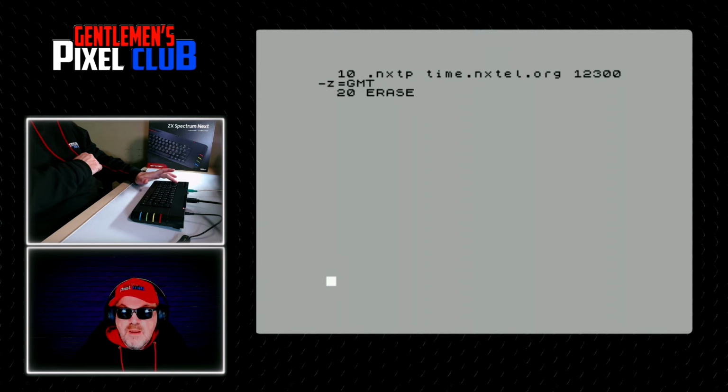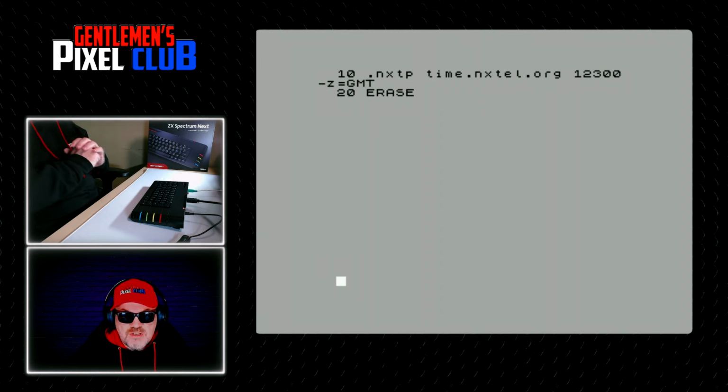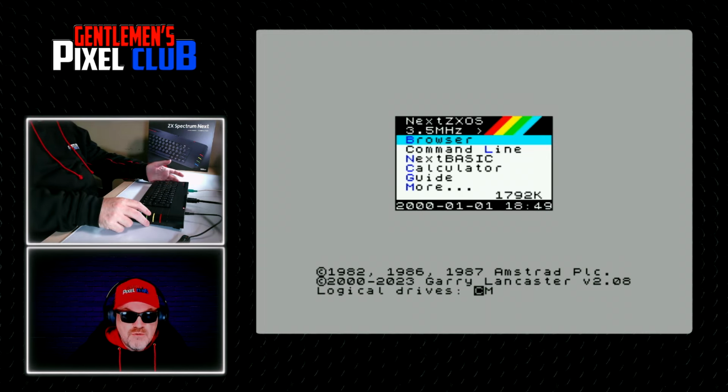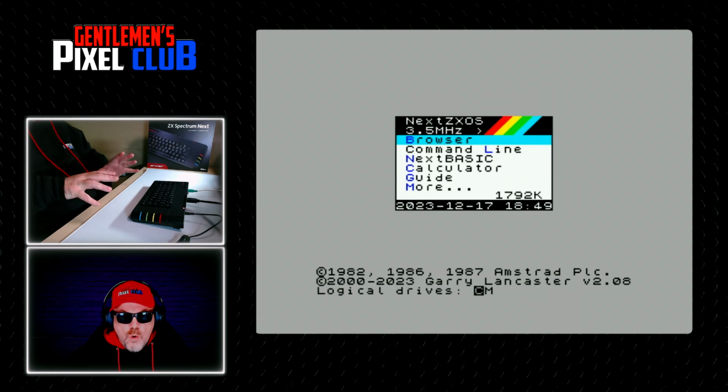So remember, we can't really go back here, but remember that was the year 2000 the time and date was set to. I'm going to reboot the Spectrum by powering off, and we will power on just to do a hard proper reboot here, and watch very carefully as it boots. So something flashed up, you didn't quite see what it was there, but if we do a reset, there we go. So the Wi-Fi is initialized and it is now set to the 17th of the 12th 2023 at 1849. That, ladies and gentlemen, is how, if you've got Wi-Fi set up on your ZX Spectrum Next, you can now have effectively time and date as well to always, always be correct.